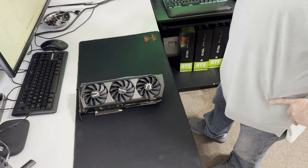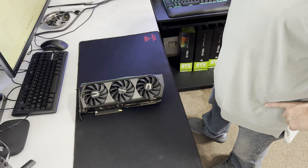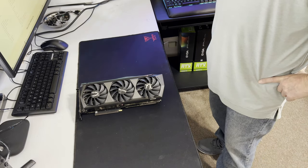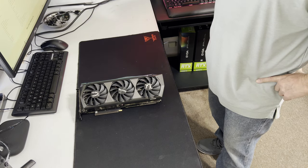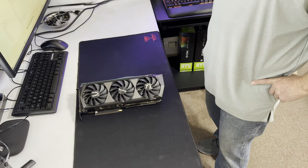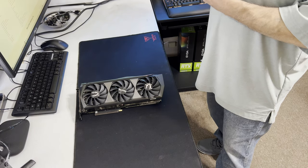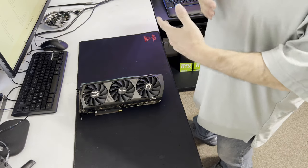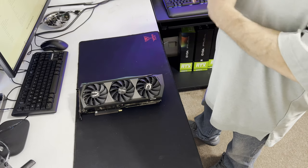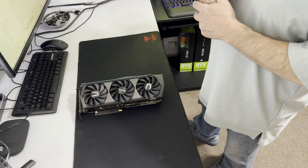Okay, so as far as the rest of the specifications go, we'll go over those real quick. Of course, the 3080 Ti is basically based on the 3090. What do they call that? The 102 chip? I'm not sure. But it has 10,240 CUDA cores. Video memory of 12 gigabytes of GDDR6X. 6X, again, we're going to go over this real quick, is double the bandwidth of GDDR6 memory. Like I said, there's something they implemented in that chipset, PAM4, which allows it to double the data rate flow of the GDDR6. So the memory bandwidth you get is just so much faster.